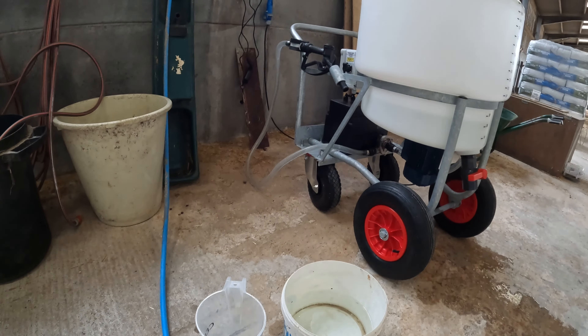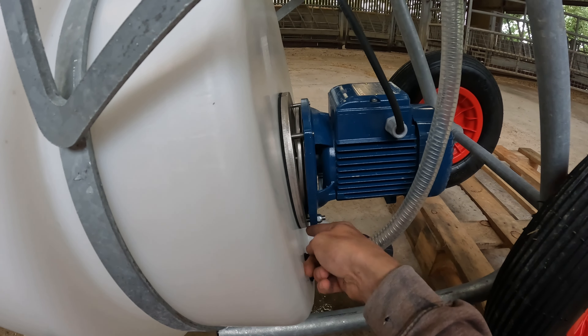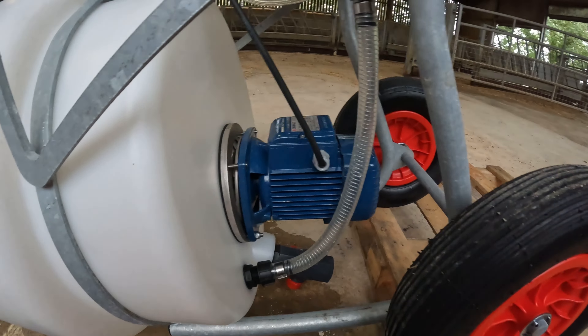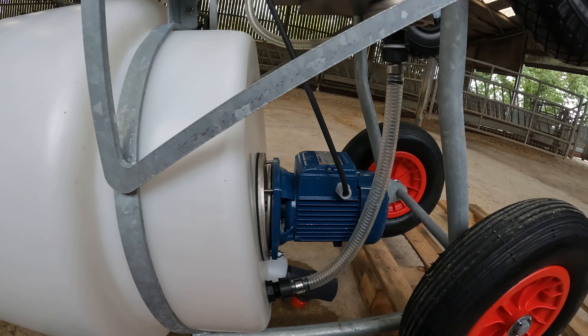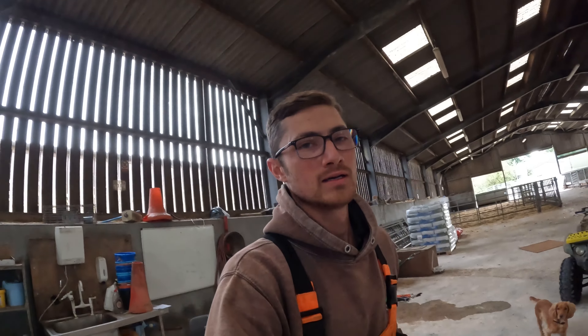Eventually found the problem with the help of Gus. From undoing the motor here that runs the mixer, I exposed this O-ring. If I very carefully use my pocket knife, the O-ring was pinched between this bit of metal and this bit of metal - it wasn't seated right where it should have been in that groove. I'm hoping it was the fact that it was pinched funny and out of place that was making it leak. I want to take this one off and just make sure I can see the O-ring all the way around. It's got to sit in that groove. You've got to be able to put this pump on square, because otherwise it's going to pinch down there when you do it up.